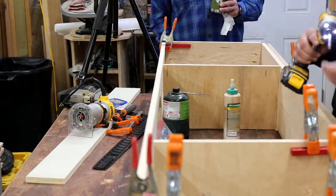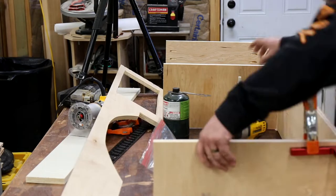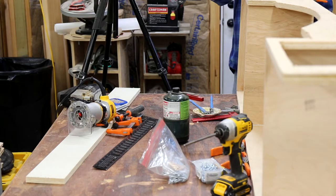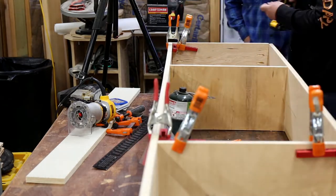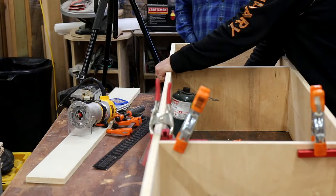After we get the bed side framed out we're going to move over to the passenger side of the truck. That's going to be leveled with the camper shell frame that's bolted to the top of the bed — that way it extends the shelf from eleven and a half inches to closer to thirteen and a half to fourteen inches, opening it up and making it a bigger storage area. On the right-hand side we're cutting this lumber down; he had pre-cut pieces to roughly six foot three, which is the measurement we need so that when you shut the tailgate everything still fits inside with a little gap.